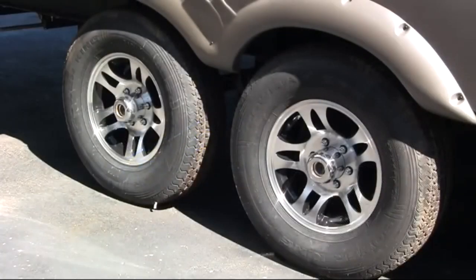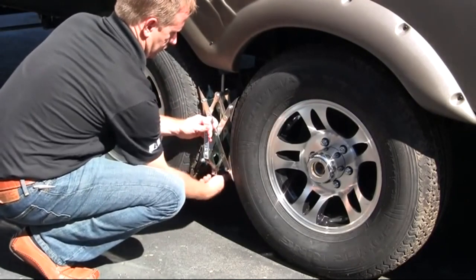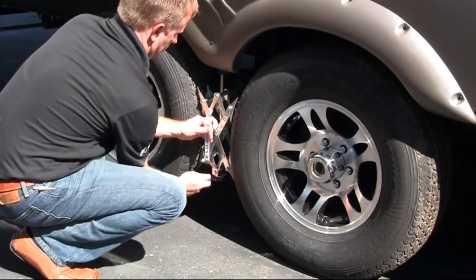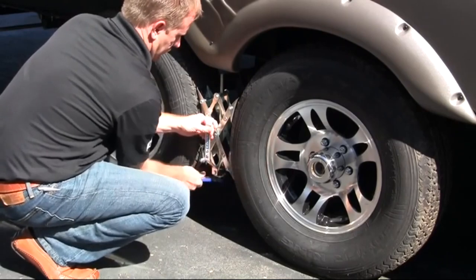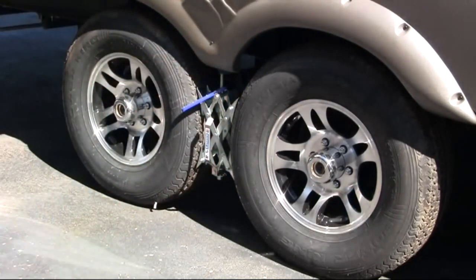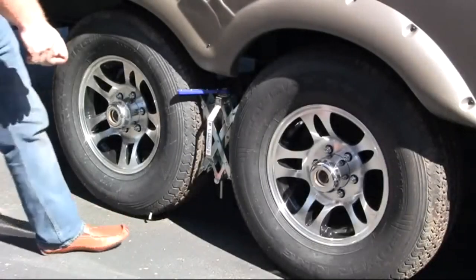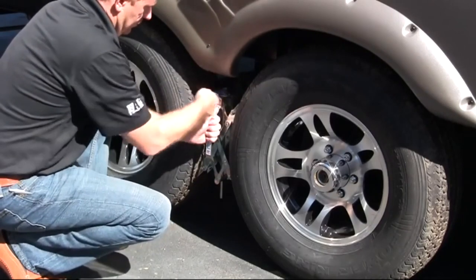If you have a trailer with an extended wheel skirt that interferes with the operation of the ratchet wrench, turn the X-Chock over and install as described. The X-Chock will work fine in the upside down position. When you are done camping and before hooking the trailer to the tow vehicle, remove the X-Chock by reversing the ratchet wrench.